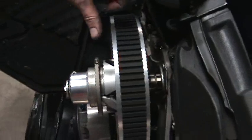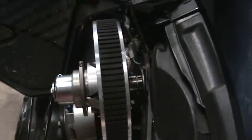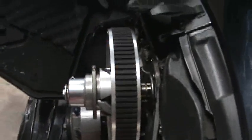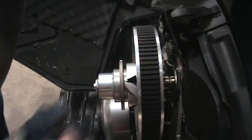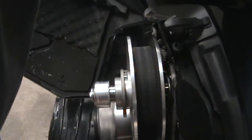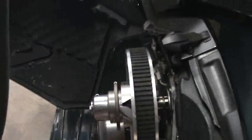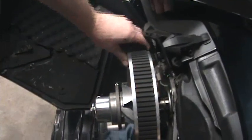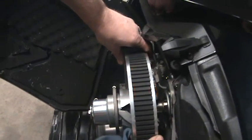Now, how we can determine how much your sled is out of alignment: we recommend pushing the clutch all the way in, then starting the sled. When you run the sled, you'll be able to see how much the clutch wants to move in or out. At that point, you can see that the clutch wanted to move out at least 80 thousandths from where it was originally.